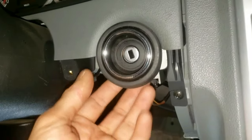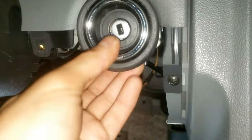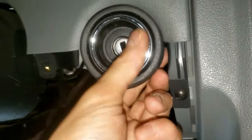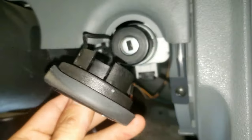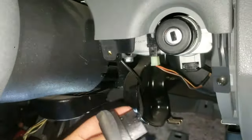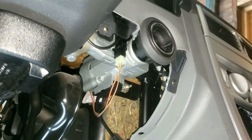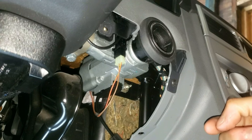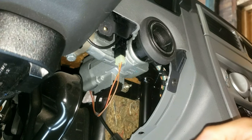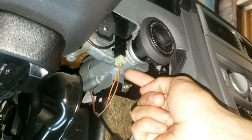Now while on this side, I'm going to remove the transponder ring by carefully twisting it counter clockwise. You don't have to do this — I'm just making sure it doesn't feel sticky behind this rubber ring. Also, if you look underneath you'll see the entire key assembly. I have a different video on removing the entire key assembly, which is done if you're having problems with your steering wheel or it's hard to turn — that will be in the description below as well.